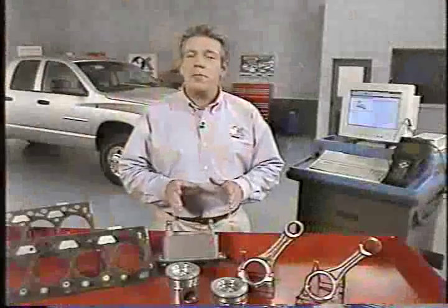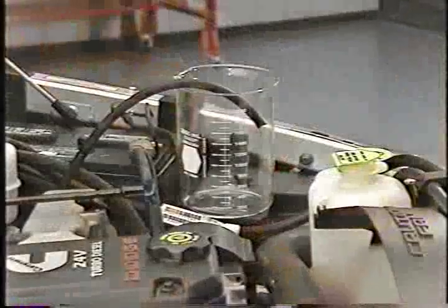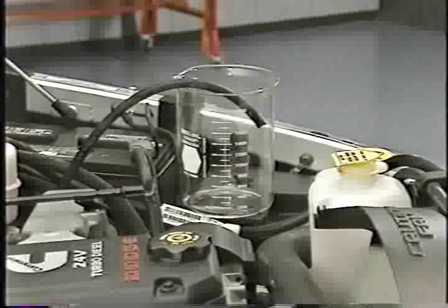If this still doesn't bring the flow below 180 milliliters per minute, you need to check for leakage past the injectors and related components by isolating one injector at a time. Tool number 9011 is used to block off fuel between the fuel rail and high pressure connector one injector at a time. When the fuel amount falls below 180 milliliters, you need to inspect the blocked-off fuel injector and related components for damage or wear.